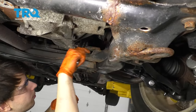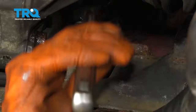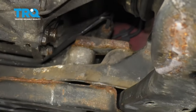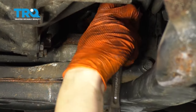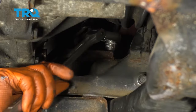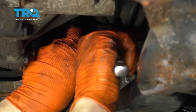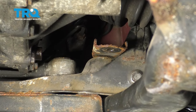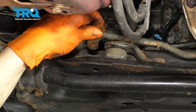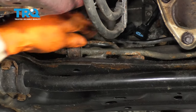With the 17 millimeter, I'm going to remove this bolt that holds the steering rack in place. That's one, and then I'm going to loosen this one up — I don't have to remove it all the way. The reason I don't want to remove it is because I just want to pivot this bracket out of the way. From the backside of the power steering rack, you see these lines — these are technically supposed to be bolted down: one 10-millimeter bolt here and another one on this bracket. Someone already removed those for me and never put them back, so I'll try to put them back when I reinstall.